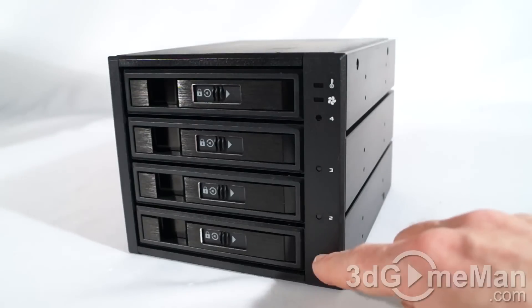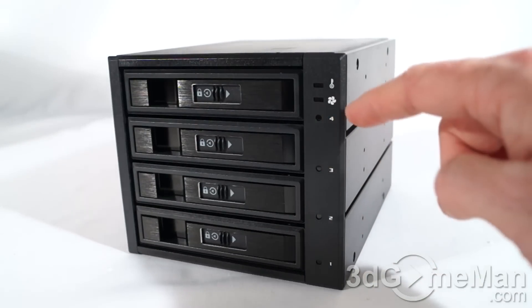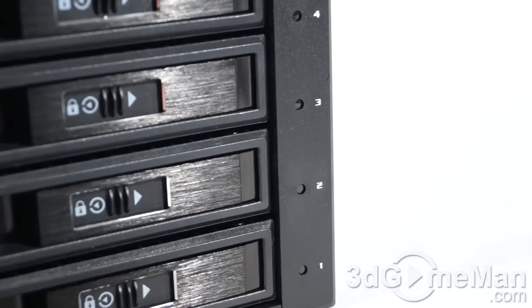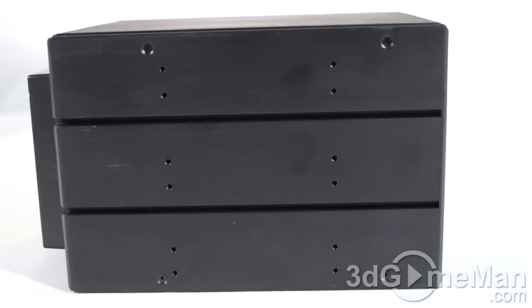On the right you've got a number of LEDs for the drives, plus one for the fan and temperature. The temperature LED: green means everything is normal, red means you're exceeding the set temperature. For the drive LEDs: green means powered on, green with an orange blink means there's disk activity, red means the drive is powered but there's no data connection at the back, and no LED means no power to the drive bay and no drive in the tray.